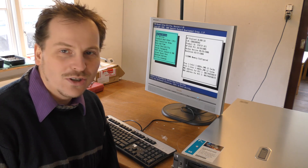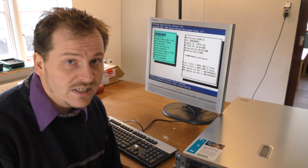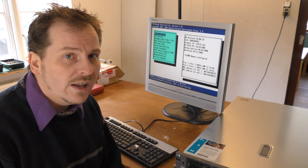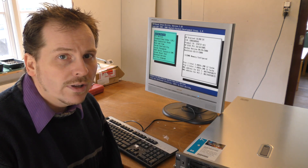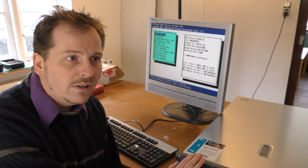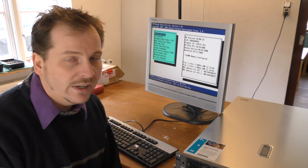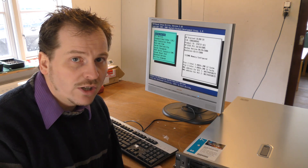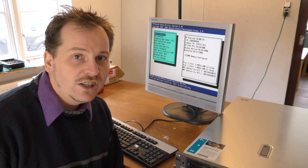I got into the BIOS of this old server — it's 11 years old, which is old for a server. The CPUs are 64-bit, but they are missing the virtualization extensions in the instruction set. They have Hyper-Threading and 64-bit support, but they're missing the virtualization instruction set, so you can use this server for ESXi up to version 3.5 but it's not compatible with anything above that. Right now I'm trying to download a CD to do a firmware update, and I'll try to boot from a USB stick instead — but that was a rather big tour of the HP DL380 Generation 4.